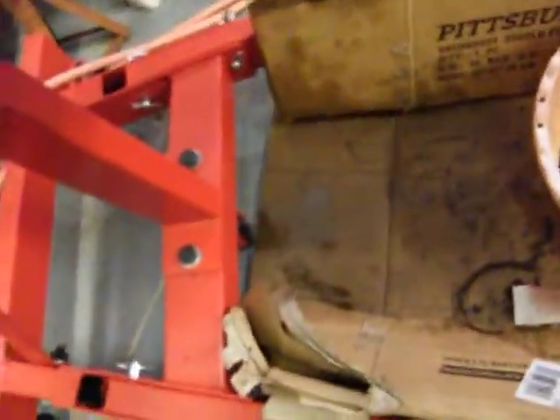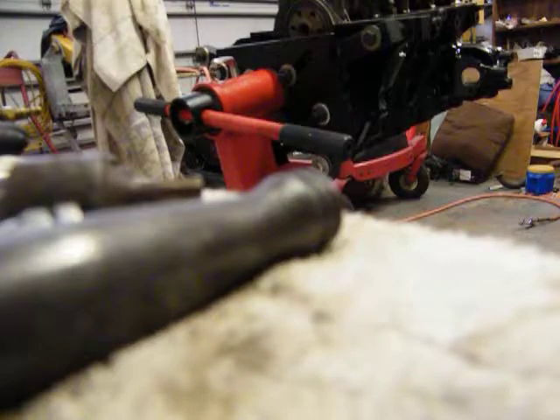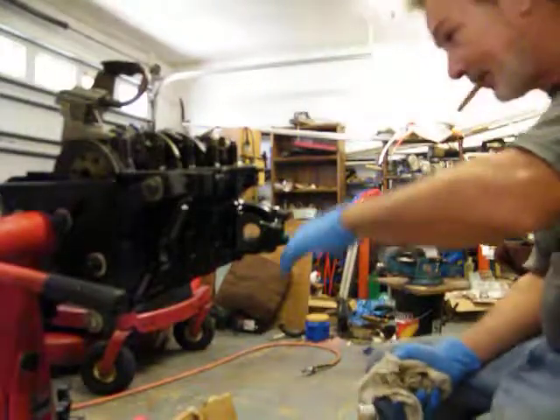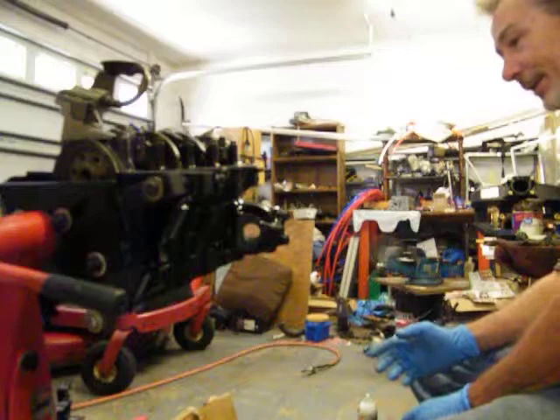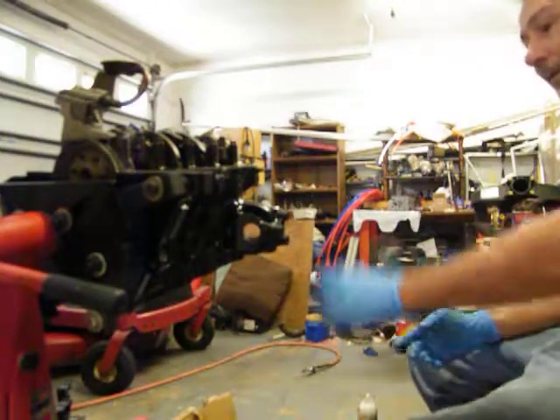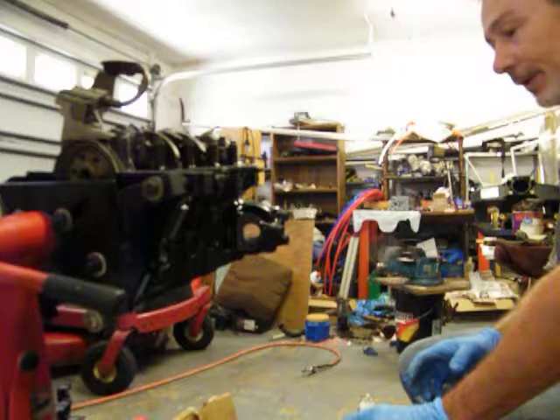Last night I filled the cylinders — put all the pistons halfway up in the cylinders — and then I put oil in there and filled it up a good eight inches above the piston heads. You can see where it leaks out a little bit — that's where it just slowly goes around each one of those ring gaps and works its way down. Tomorrow I'm gonna let it set tonight, put the pan gasket on, get the bottom done, flip it over, bring them all up to halfway, and then fill the cylinder heads up on top and let it seep down into the motor.